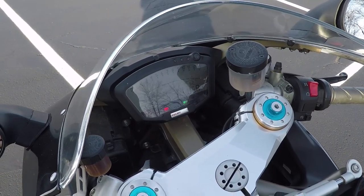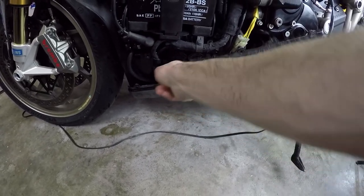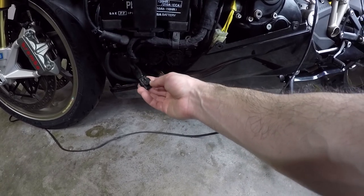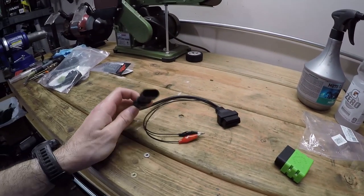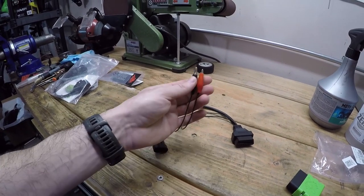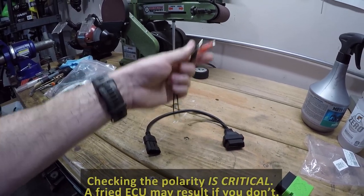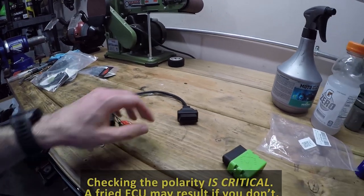And how I did that was, firstly, locating the diagnostic port, which is right here under the battery. It's just this little wire that's hanging freely. It's got a cap on it. You remove that cap and you hook up a special cable over here. And I'll put links to all of these items in the description of the video. And this goes into the diagnostic port on the bike. These alligator clips you hook up to the battery terminals. You'll also want to make sure the polarity of these is correct. I'll put a link in the description as well on how to determine that.